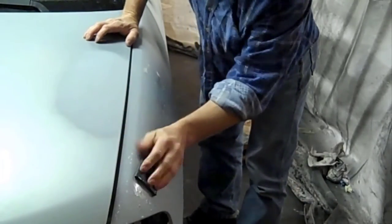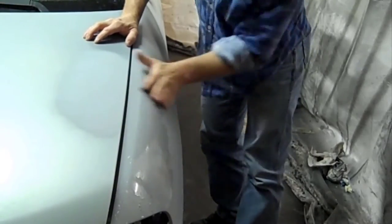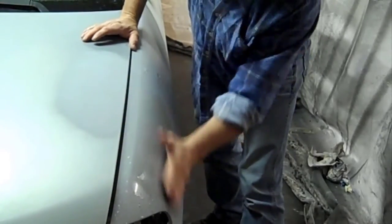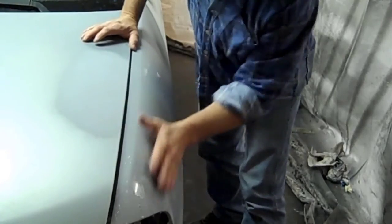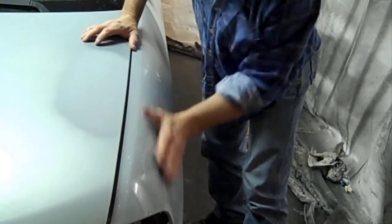Here I'm wet sanding with a little rubber block. I call them a squeegee block. I'll put that also down in the description. It's smaller so that I can actually ride these curves better. And I'm sanding with 400 grit to slick the fender up.